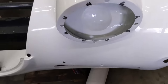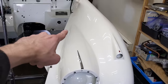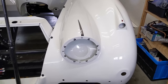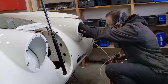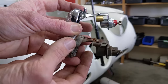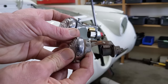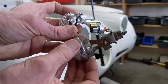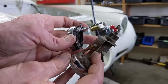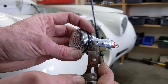For a third layer of protection, I'm working with this cavity protection spray gun, running it all through and into the metal sandwich that runs all the way up the fender and also into the side light repeater. Now with the pod full of cavity protection spray, I can put the light in. You can see the original unit had chrome pressed around the housing and glass — there's just no way to renew it, it's an unrestorable piece. Luckily I found high quality reproductions. The end is slightly different so I'll modify the harness and put a bullet on there. It seals on an O-ring and attaches with a top-mounted screw.